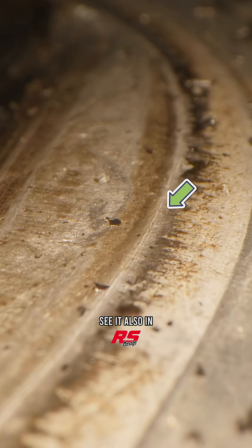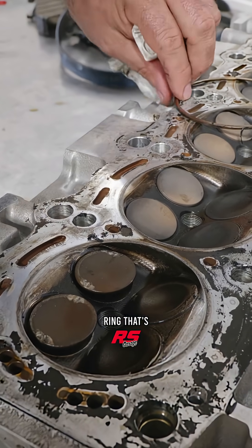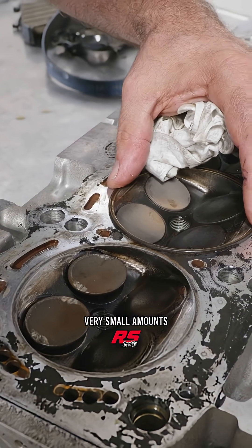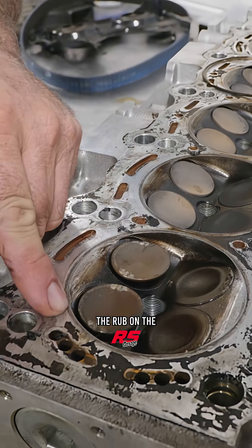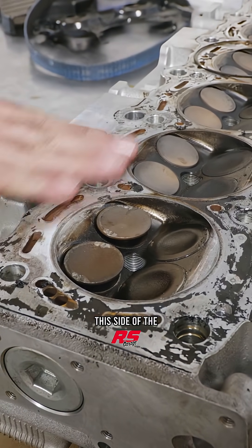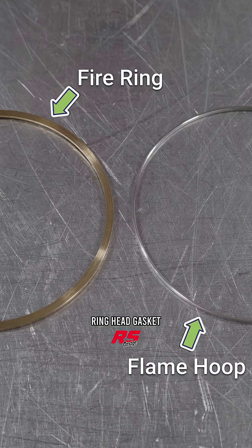You can also see it in the signature here — this dark ring is not oil, it's vibration. You have this ring vibrating very small amounts and the head vibrating very small amounts, but they rub together over time. The signature of the rub on the exhaust side is quite different from the intake side because this side of the head is hot — there's more expansion and more bedding. This is one of the things we talked about with the fire ring head gasket and the flame hoop head gasket: things are going to be moving, there's no way around it.